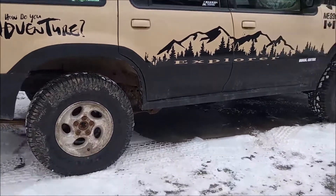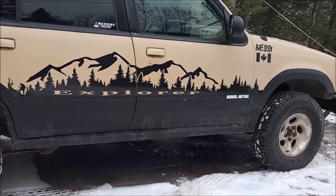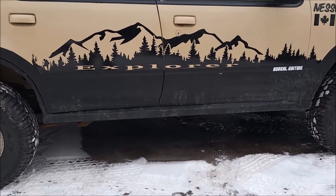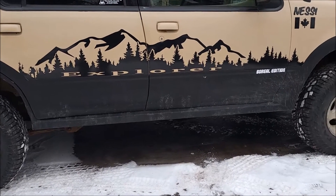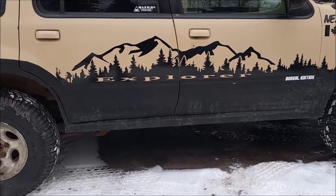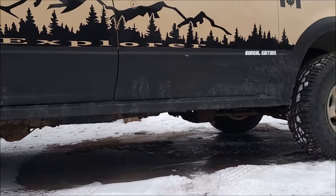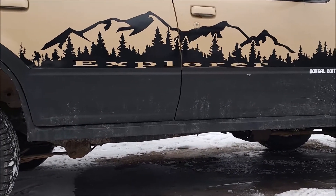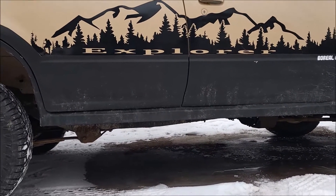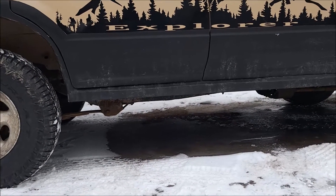The body work was done. You'll notice something different about the rocker panel area — there are no rocker panels. What used to be rocker panels is now 2x4 structural steel, all welded in. Gives it a nice flat area, so it's a rocker panel and potential slider all in one. I am going to get a set of side steps made for it.